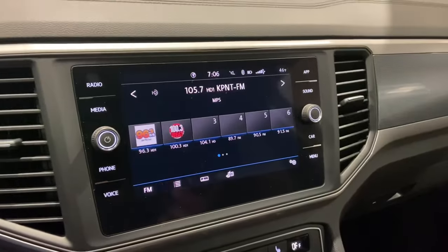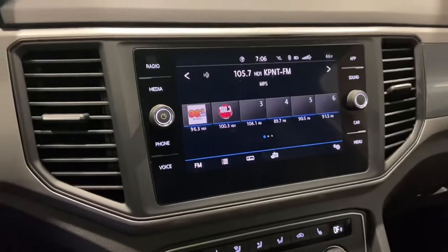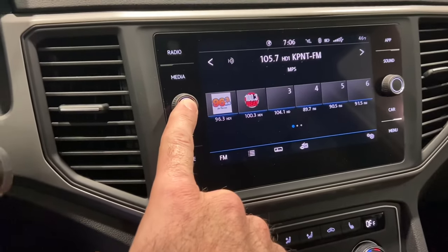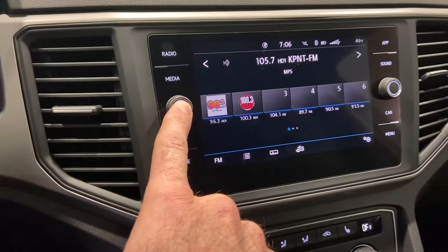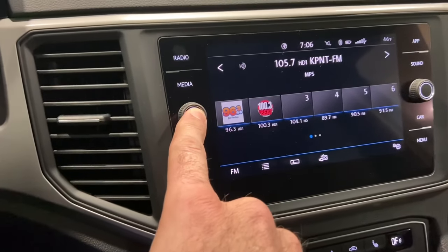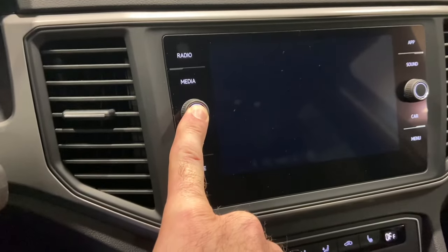I'm going to show you how to do that right now with a little 10-second reset. I've got the infotainment system on, and the car is on but not running, because I want you to listen — when it does do a reset, you actually hear the fan kick up, kind of like your regular old PC at home. So I'm going to hold this for 10 seconds: 1, 2, 3, 4, 5...